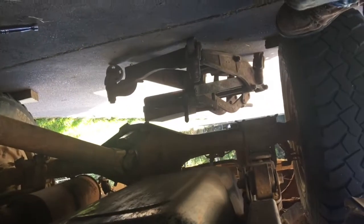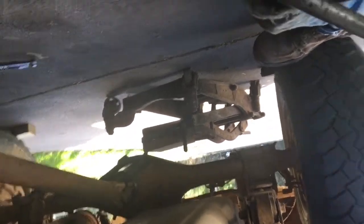This is my gigantic transmission jack for tractors, but you gotta do what you gotta do. Whenever I get this loose and start taking the bolts out of the transmission, I'm going to put the jack right here, jack it up some so everything's level, and then start removing the bolts. Then since it's a standard, I have to use pry bars to pry the transmission apart.